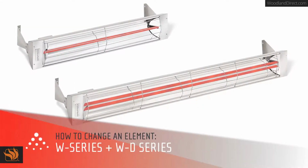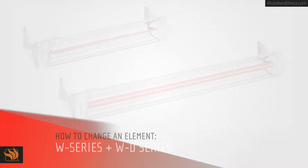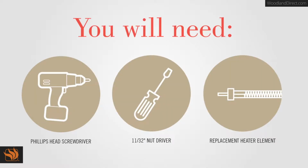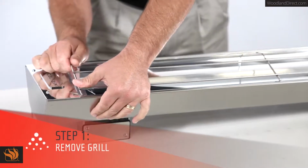In this video, you'll learn how to change the heating element on an Infratech W-Series heater. Before you get started, you will need to disconnect the power at the breaker. Then you'll need to gather the right tools for installation. To get started, the first thing you'll need to do is remove the grill.